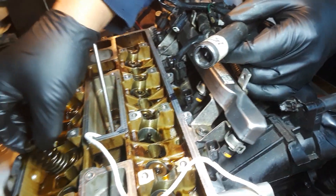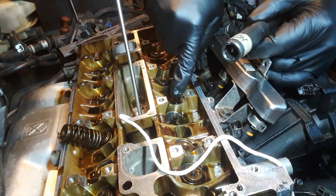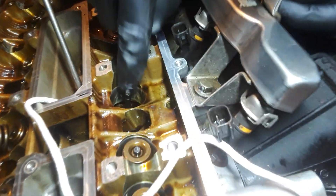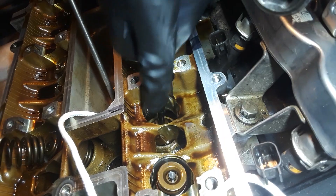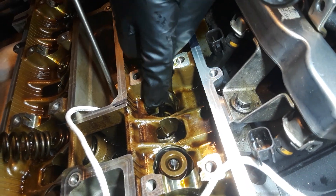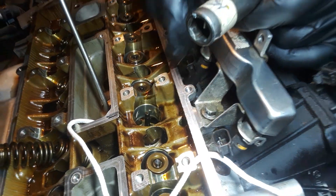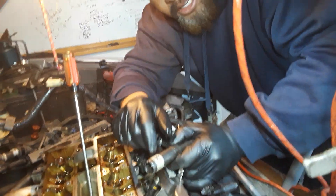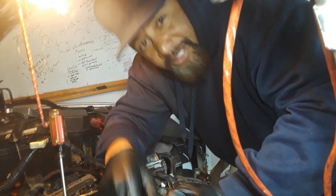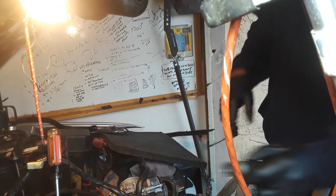All you got to do is use rope. The reason you use rope is so the valve doesn't fall inside the cylinder. Right now it's stuck right there in position because we got the rope holding it up against it. Anyway, that's an old school trick right there — goes way back to the old school days. That's how you handle that — go get it, let's go.